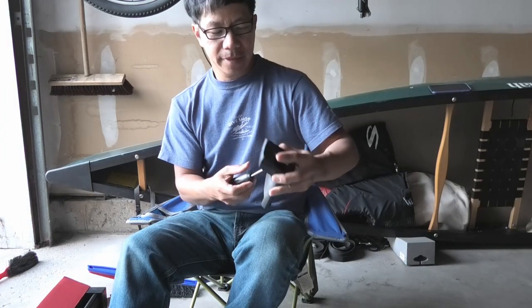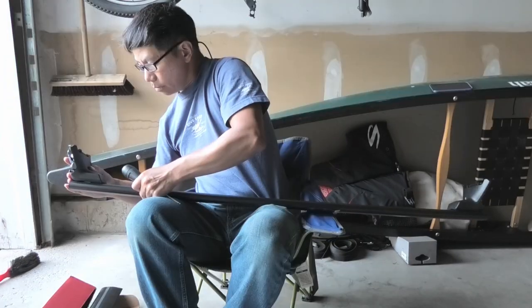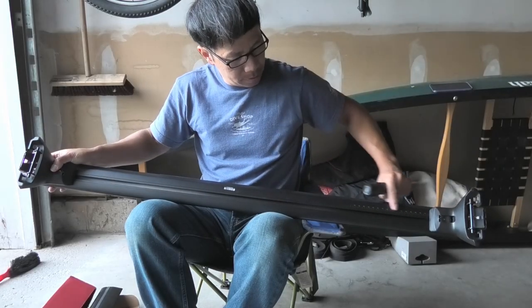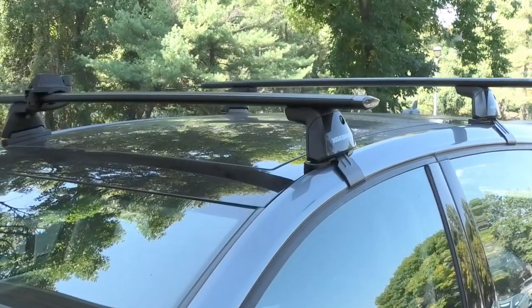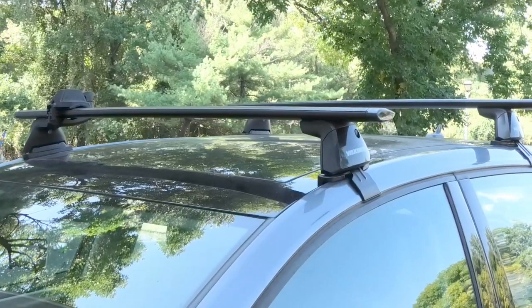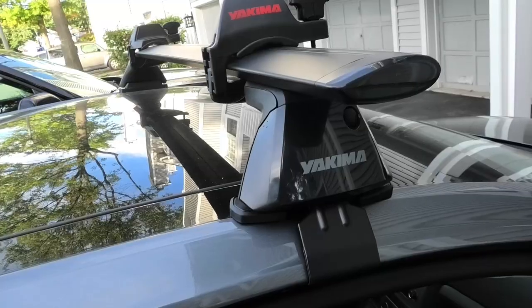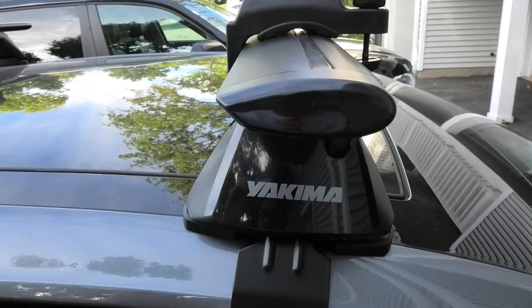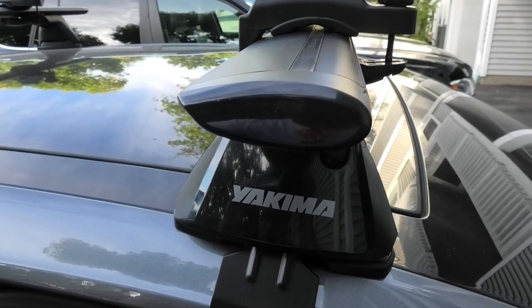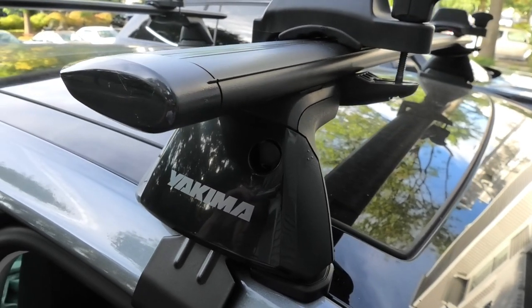So I'm just putting the adapter that will fit this base to the crossbars. And there are these measurements center to crossbar on the top. The crossbars are all assembled and it looks pretty good. Make sure you screw on all parts as firmly as possible. Notice the direction of the crossbar wing shape — the rounded, thicker part is facing forward. In this case, the front of the car is to the right. That direction gives you optimal jet streaming, the least wind resistance and noise.